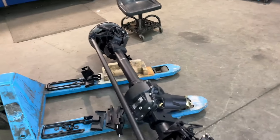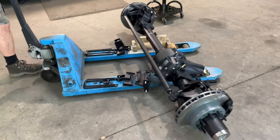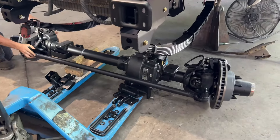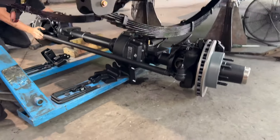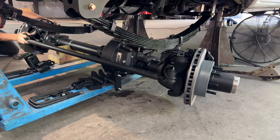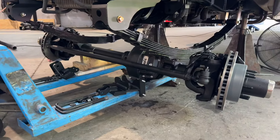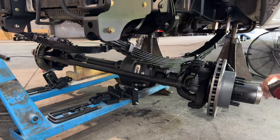And the moment we've all been waiting for. This is a Stage 3 front axle — pulling no punches on this build. Stage 3 spec, 4.56 gears, Detroit True Track with Dynatrack knuckles, hubs, and spindles. Everything from the knuckles out from our boys at Dynatrack. It went right in over there — line up the driver's side, get the U-Bolts and U-Bolt plates attached, and this thing has its forever Dana 60.